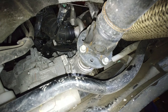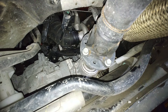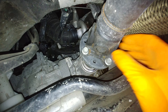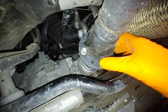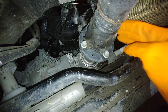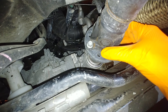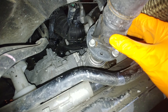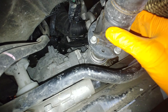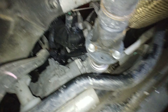There are no codes or anything when you try to go up a slippery surface like a snowy hill. You get this grinding noise — it almost sounds like a bad coupler, but there is no bad coupler here. The noise is definitely coming from here, but no all-wheel drive. The wet road surface light will come on, your ABS light will come on, different stuff like that — it kind of freaks out. But it self-clears and doesn't recognize any faults. It just recognizes that the front wheels are spinning and the rear wheels are not.